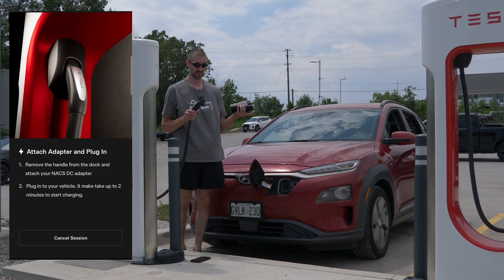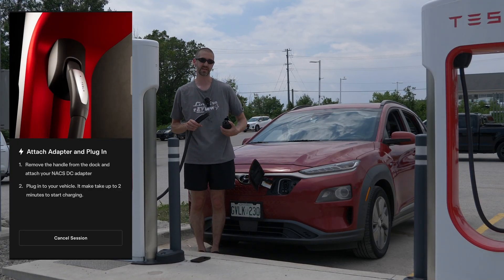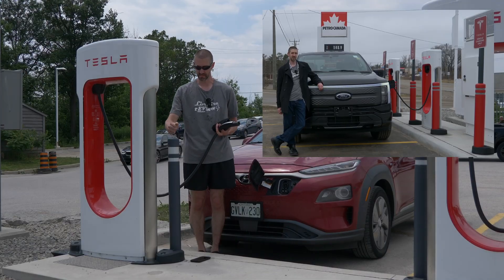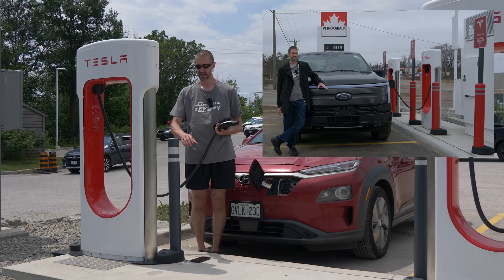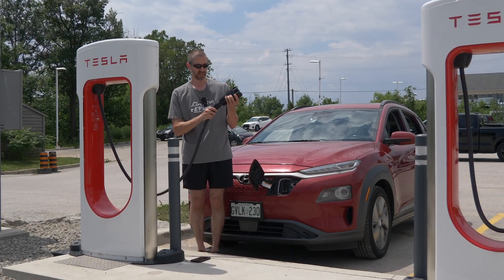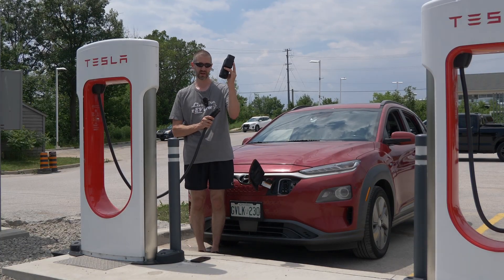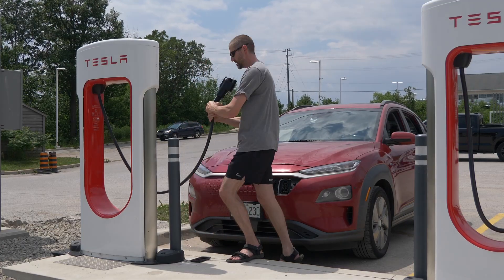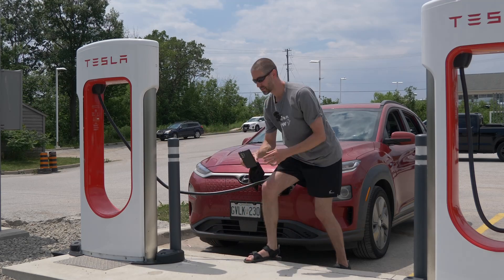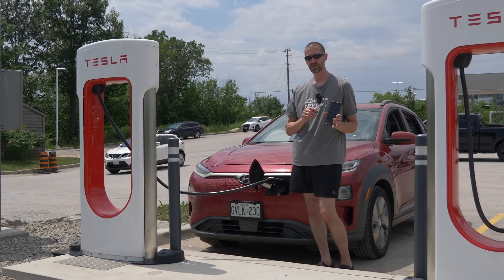One of the reasons I like the Kona is the charger is on the front. It's going to be harder if you try to charge an F-150 Lightning or something with a charge port on the side — you'll have to get up really close and block a couple of spaces. I noticed they took out the larger bollards that were blocking access and replaced them with smaller ones so cars can get closer, since the cables are short. First, you press the clip on the bottom of the adapter and click it into the supercharger, then bring it over to your CCS port and plug it in — no button press needed there. At this point communication happens in the background; pick up your app and give it a couple of minutes.